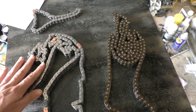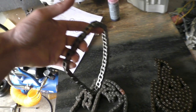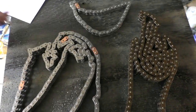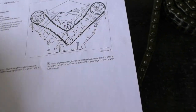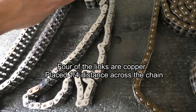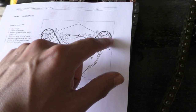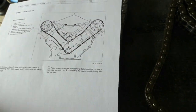Getting to how to install these timing chains — when you buy them they come open-ended, not closed as a loop, and you have to crimp one of the ends to close them. For installing the timing chain you have to follow the diagram in the service manual. It tells you the location of the copper lugs — a few of the links are copper and these have to go in certain locations, lining up with marks on the timing chain sprockets to get your timing right.